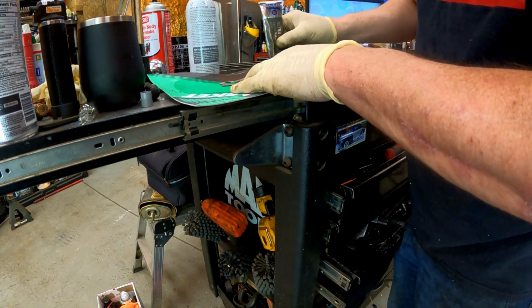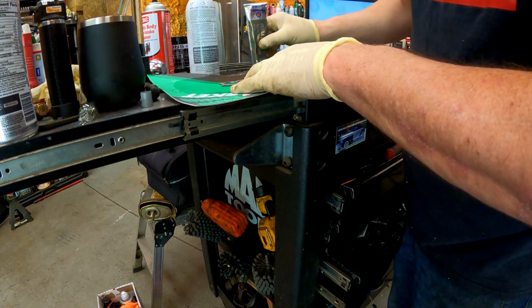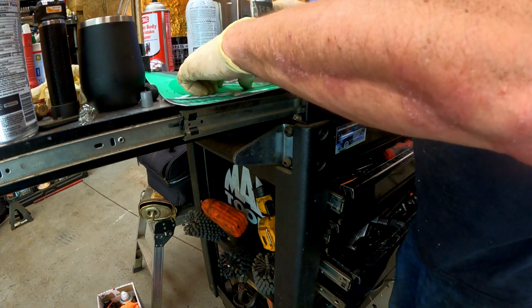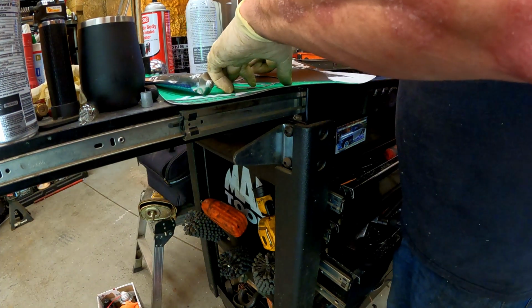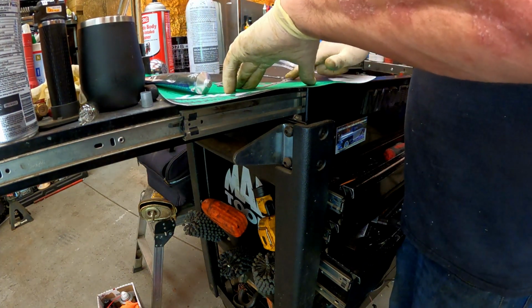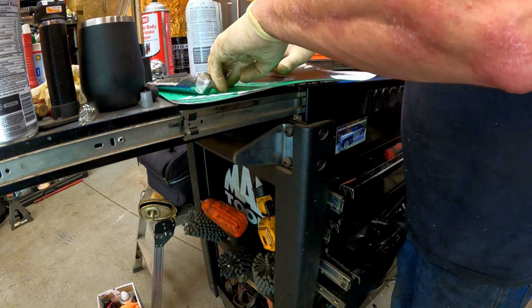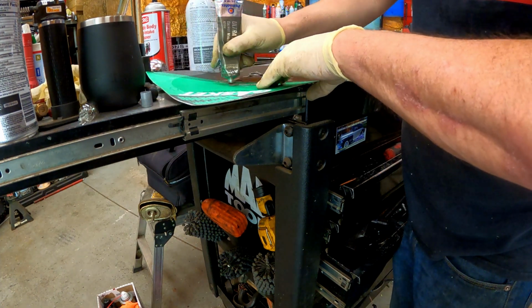This gasket doesn't have a whole lot of room to seal. It's pretty thin around the edges where the head or the cylinder base bolts, so it's going to be good to put a little bit of sealer on it for sure. Don't have to get crazy with it. Basically going to squeeze it all out anyway when we bolt it down. So this is just added protection really.